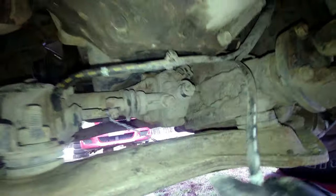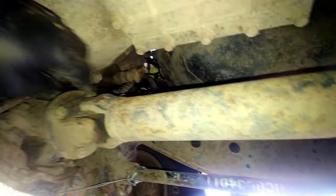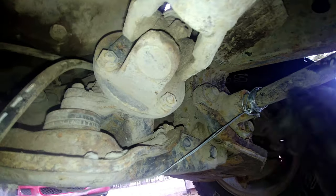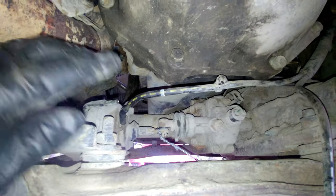You don't want to go on the highway with the front end locked like this. And when you switch to 2x4 at the transfer case, you won't get torque transfer to the front end, but your front axle will still be locked. If you don't need it, just undo the wire and that will unlock the front end, then try to shift to 2x4.